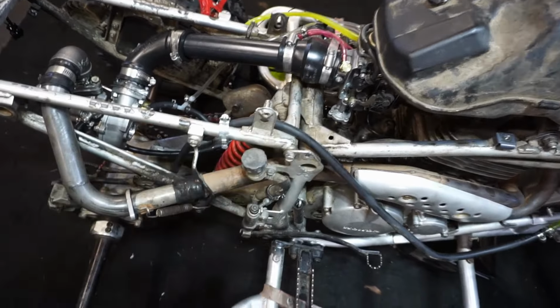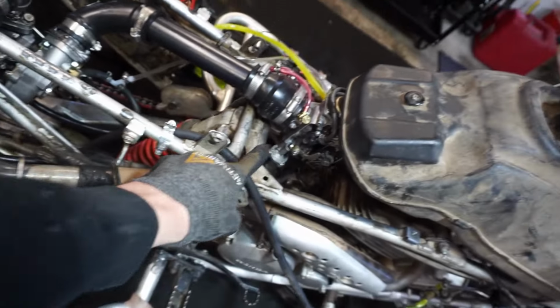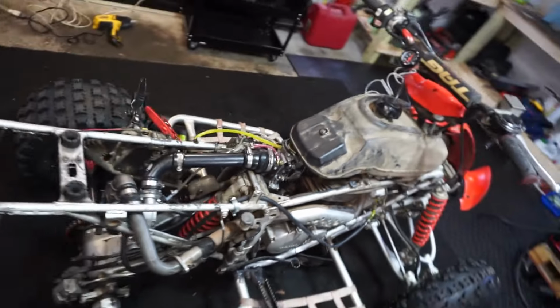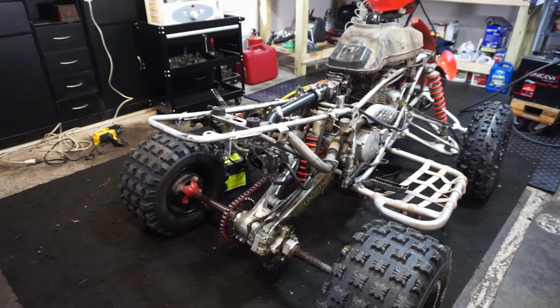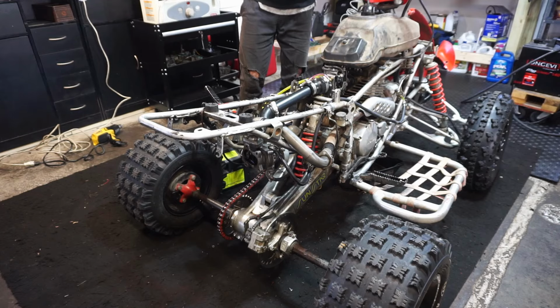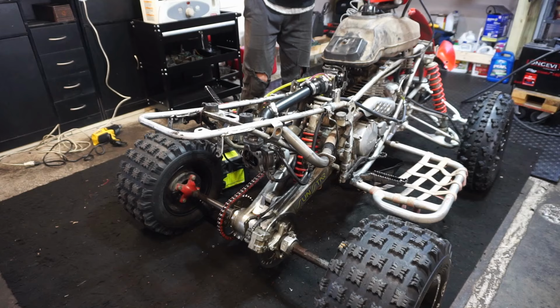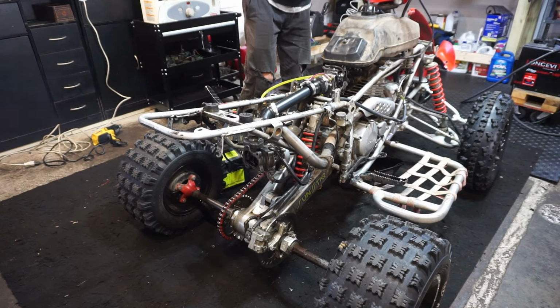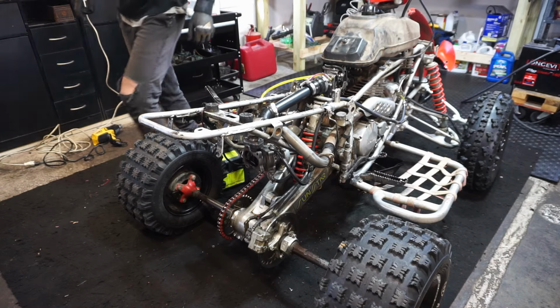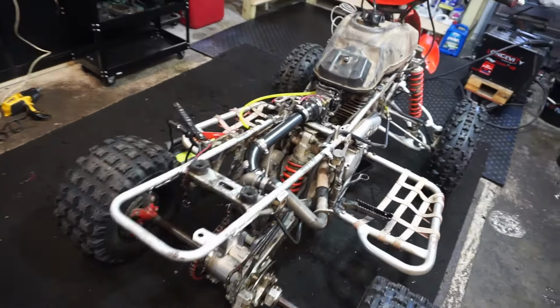All right, I forgot to plug off the drain bolt for the carburetor, so that needs to be referenced to boost as well. So I just did that. It's down here. That line's going to boost now. So hopefully that helps. Air was just pushing out of the carburetor. Alright, that runs a lot better. So that's actually revving out now.